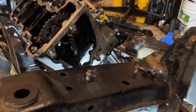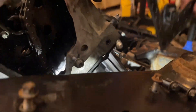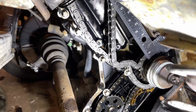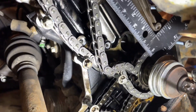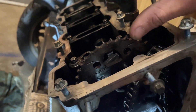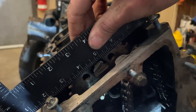What you're going to need is a square or a level. The first thing you're going to do is line up this little key down here — you can see that on the nut — to this line right here. You take your square, put it up here to the edge of this, look along the edge, and if it's straight up and down you're good. As long as that line is parallel, it's marked properly. Next, you take the square and you see these two markings right here — one here and one here — you make them level with this piece. If the markings are perfectly exact, you're good to go.